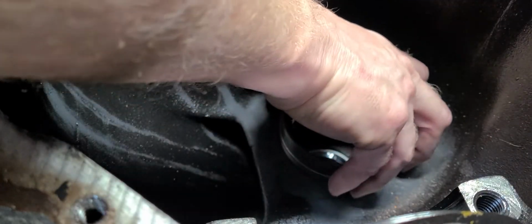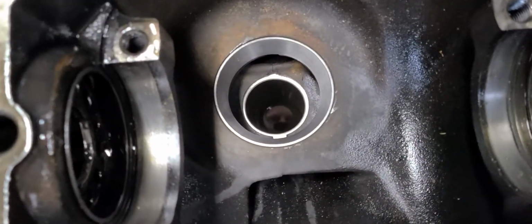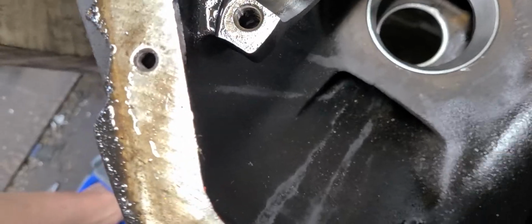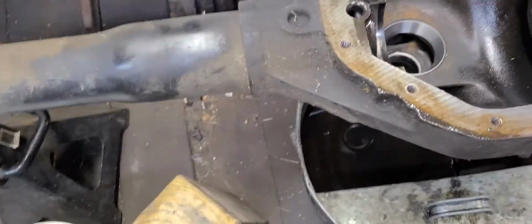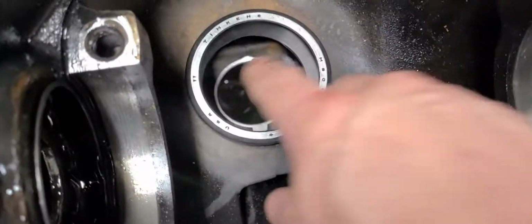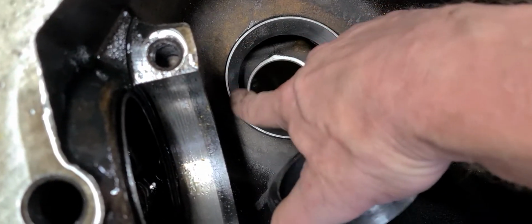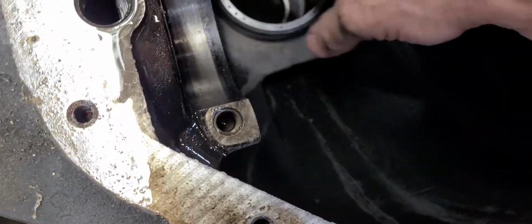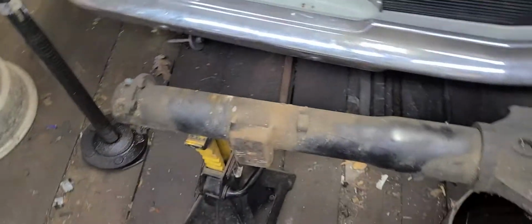Okay, I'm going to have to resort to my backup go-to. I'll be right back. Okay, y'all, I apologize for pausing it and not showing you me hammering that in, but it was simply me hammering that in, using the old race and this piece of wood, which I was trying to avoid, but it worked out really well. You take the old race, you flip it over like this, okay, and you put it on the edge of the new race. Once you get the race hammered down in there where you can't get to it with something like this or something like that. And I had it cocked. Earlier I had the race cocked, so that's why I had to go get the piece of wood, because I knew that was going to be my only option.